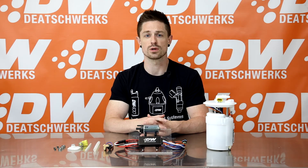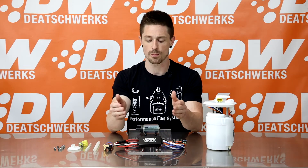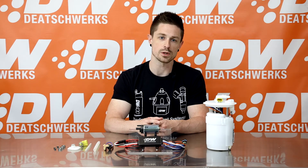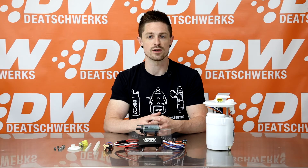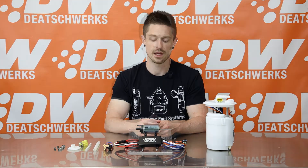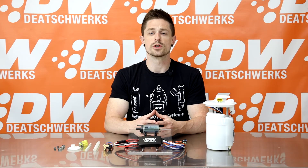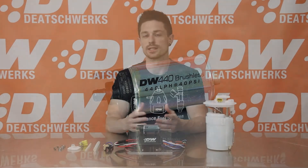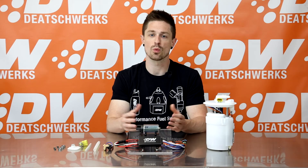The first thing you'll notice about the DW440 is its compact size. Fitting a big aftermarket fuel pump into OE modules is not an option in most cases without extensive modifications to the fuel bucket. The DW440 only measures four inches from inlet to outlet, which is two inches shorter than the competition, opening a lot of fitment options that did not previously exist for customers wanting to integrate brushless fuel pumps into their fuel system.